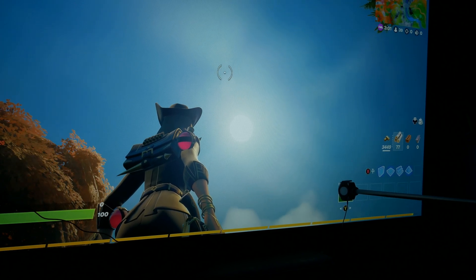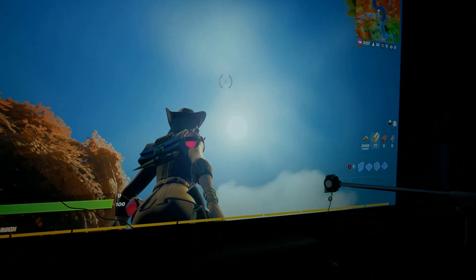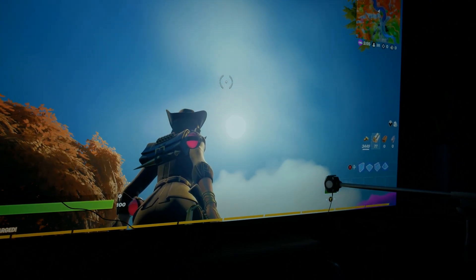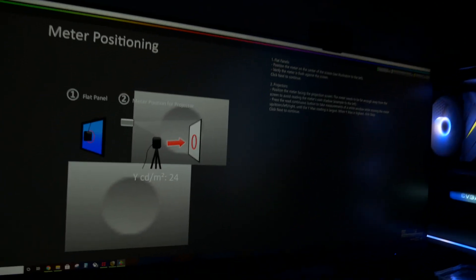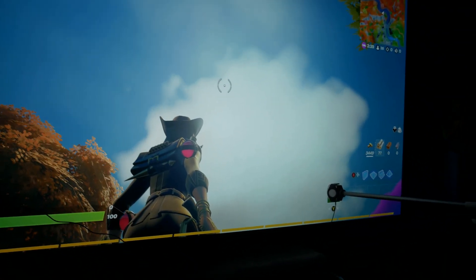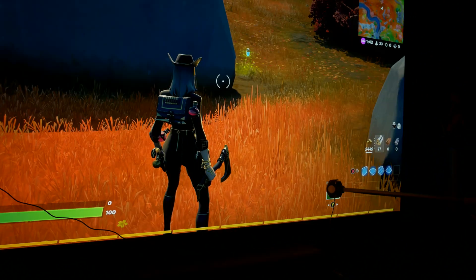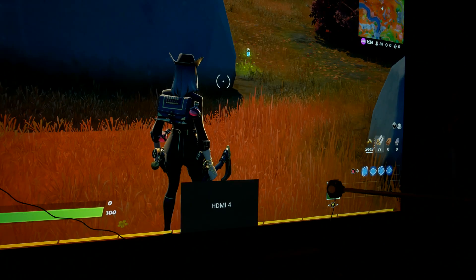This will be a pretty quick one, but I figured out a little way to measure the ABL kicking in on the A80J. I put my meter up against that static green element in the bottom right of the screen for the UI, and right now in this frame it's pretty low at about 24 nits. But then I realized I can change the input and change back and it will completely disable any ABL that had kicked in and put it back to full brightness again. So now I'm going to let the video play where you can hear me call out how bright it is at different points.